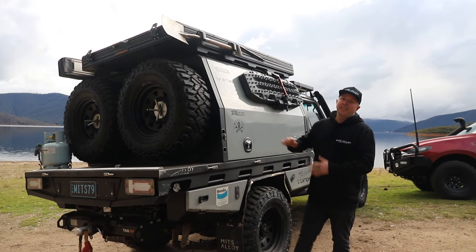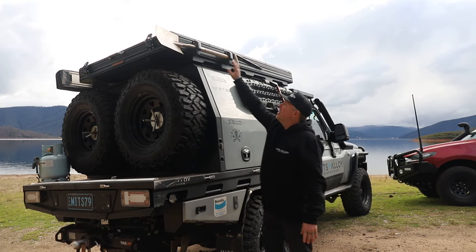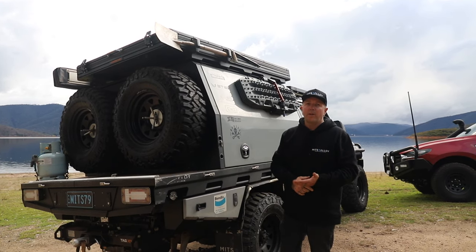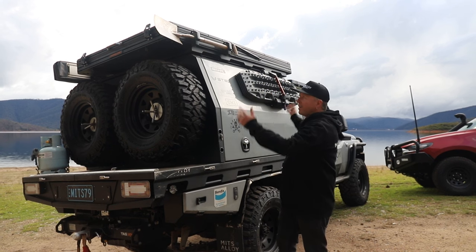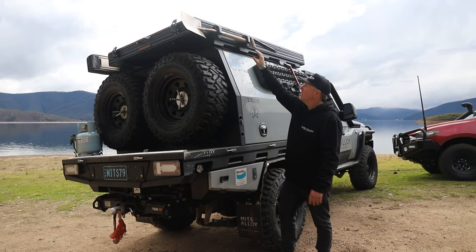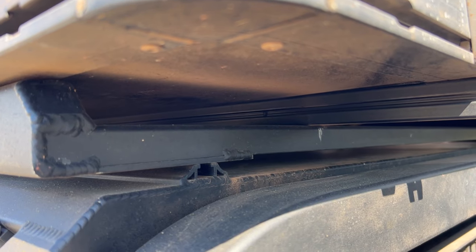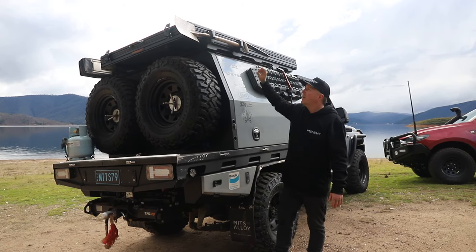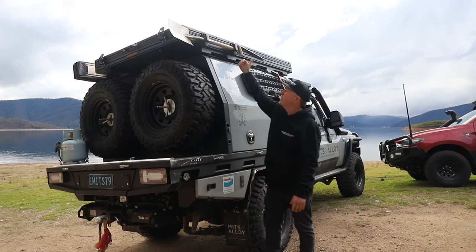Okay, while we're here, I think we should start with the Land Cruiser and the roof rack up the top here. This roof rack that we've got mounted on this canopy is our most commonly requested roof rack mounting system, which is just your full length roof rack. As it suggests, it's the same size as the canopy. This rack is mounted directly to our nut runner channel, which is exclusive to MITS Alloy. We use an M10 bolt flipped upside down, which slips in behind here